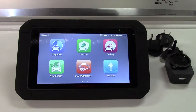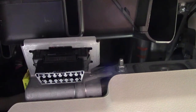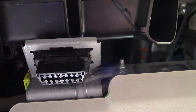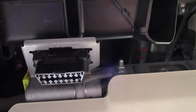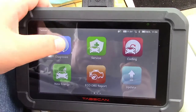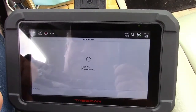Now we're going to take this out to the car and see what we can do. You want to locate the OBD-II connector in your vehicle — usually it's under the dash somewhere. Plug that appropriate end of the cable in there, and the other end goes into the scan tool. The first thing we're going to do is go to Diagnosis. This is a Toyota, so we'll hit that.